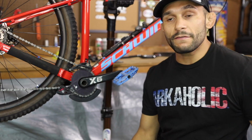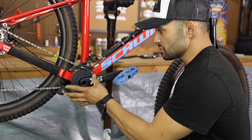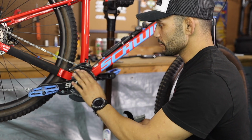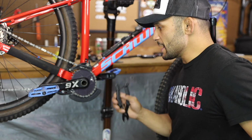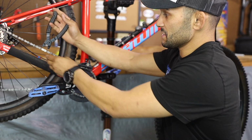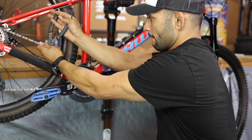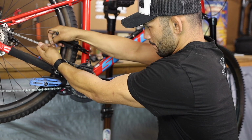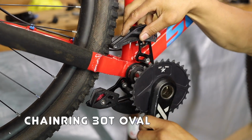Alright guys, so the first thing I am going to do is take this chain ring protector thing off here. The reason I'm going to take it off is, for one, it's kind of an eyesore, and for two, I'm hoping that with this whole new derailleur, we're not going to need that. It's going to be so awesome that we're definitely not going to need it. Well, we definitely want to see if having the clutch derailleur is going to prevent all the chain drops. And with that on there, you can't really find out. Yeah, but it is a clutch derailleur.